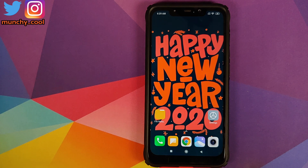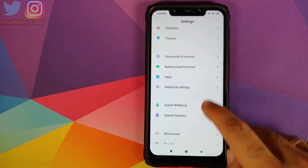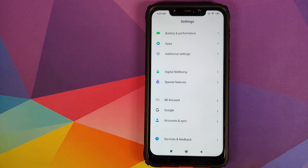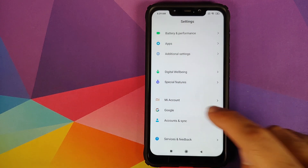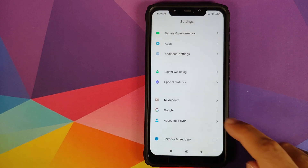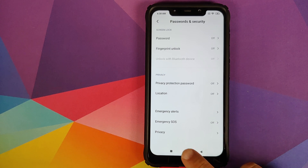All the files which you're going to use in this video are linked in the description. Next, go into Settings, then you need to go into Mi Account and remove your Mi account. Once you've removed your Mi account, go into Accounts and Sync and remove your Google account. Once you've removed your accounts, go back into Password and Security and remove your fingerprint, face unlock, and any security measures which you have set up. Once that is done, you need to reboot your device once.